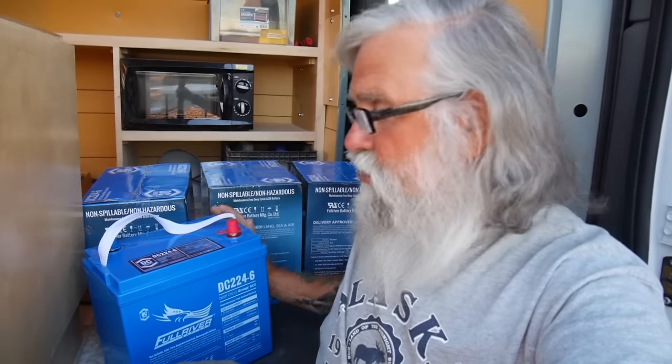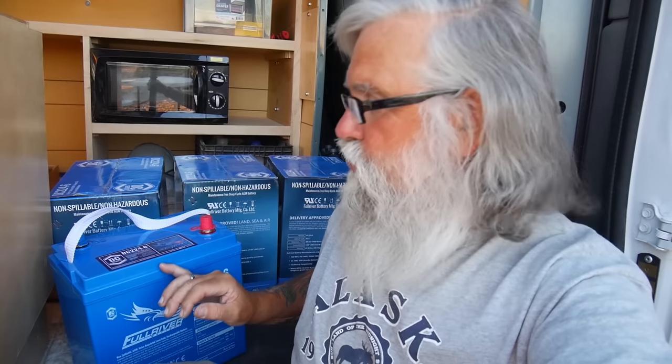These are a standard golf cart size, so they should be drop-in replacements. You can see they're taller — golf carts are taller and not as wide because they've got to fit in the small space of a golf cart. They're going in behind my two seats, one behind the passenger seat, one behind the driver's seat. They'll be connected with 2-0 wire. 2-0 is about the size of your thumb — not 2-gauge, which is about the size of your little finger. The inverter is 2,000 watts and surges to 4,000, so it also has to have 2-0 wire, which is the minimum for a big inverter.